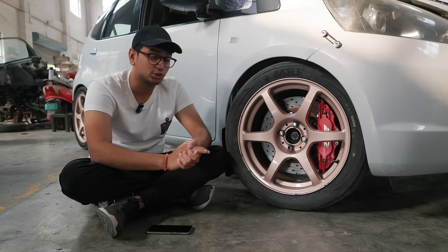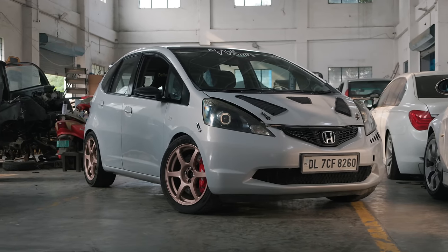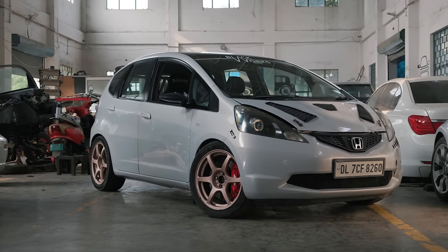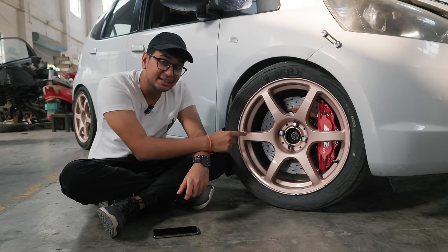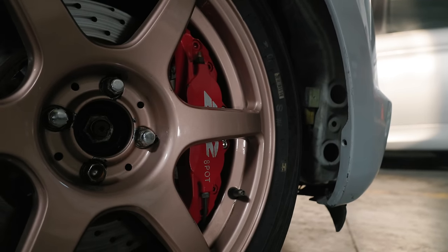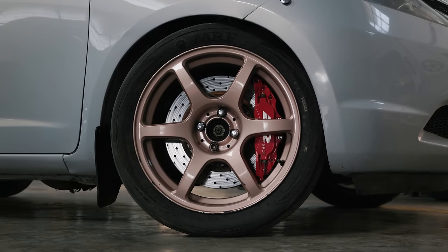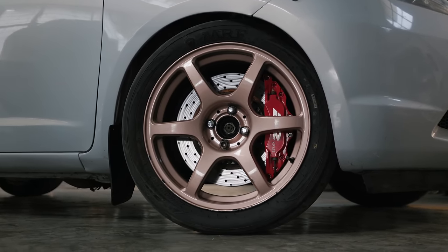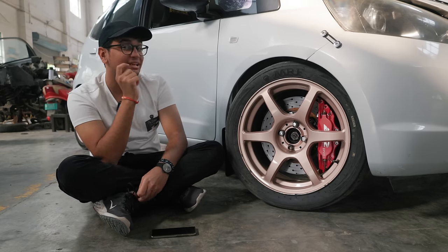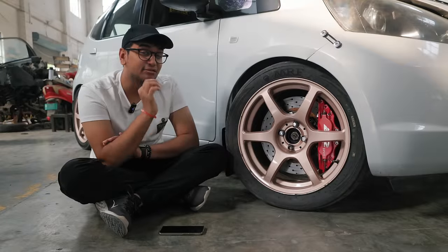This being a race car, the main emphasis is on the suspension, brakes, wheels, and tyres. Currently it's running an F-tuned race spec suspension which is fully adjustable. It has Ultra Racing sway bars, Ultra Racing front strut bar, Ultra Racing rear X-brace, and hard racing ball joints and sway bar links. Behind the lovely Lenzo 17-inch Venom wheels, you have D2 8-piston 330mm brakes with steel braided lines, Dixcel pads, super sticky MRF ZTR semi-slick tyres, an M-Factory LSD, and a racing final drive from Edge Drive.